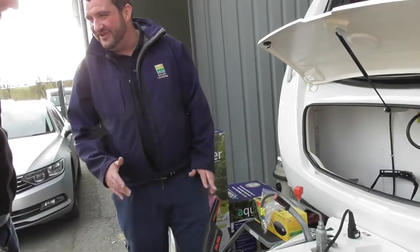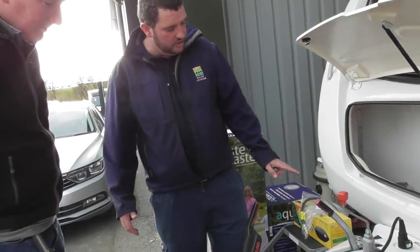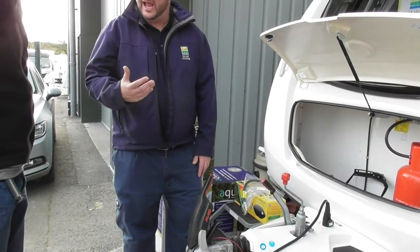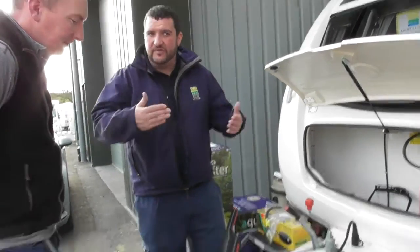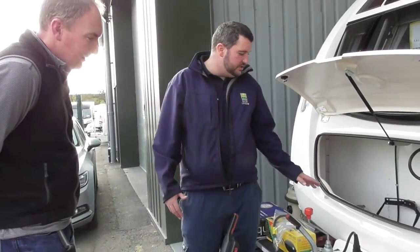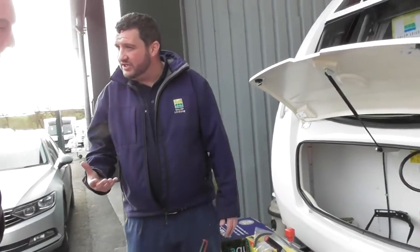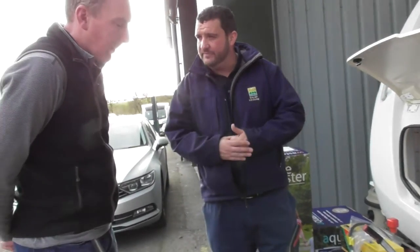If you're ever plugging it in and the red light's not clearing, first thing to do is unplug it from the car, leave it a few seconds, and plug it back in again — same as anything electrical nowadays, switch it off and switch it back on. If you've tried that a few times and it's not clearing, you can try leaving it plugged into the car but uncoupling it and seeing if the brakes are engaged on the caravan. If the brakes aren't engaged and you tow it, it just means your ATC system isn't working. But if the brakes are locked on it's a definite no-tow. I've never come across a person that's had any problems with it, but we like to give everyone that knowledge just in case.